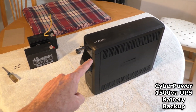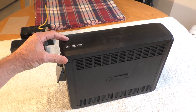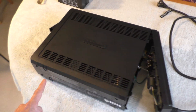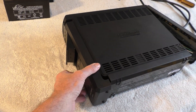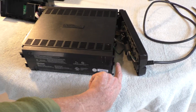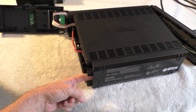Before I ordered new batteries, I took this thing apart to inspect the circuit board. To open it up, remove four screws and the back part comes off. Then remove two screws on the front and the front part slides down and open. This part took me a long time to figure out — there are three clips on the inside.